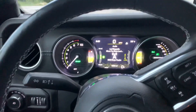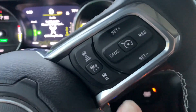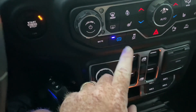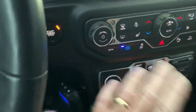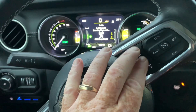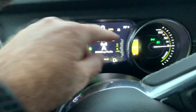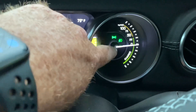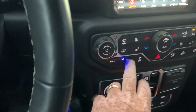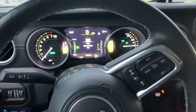What I'll demonstrate on the way back down on the other side is how to use adaptive cruise control, and regular cruise control for that matter, as an adjustable version of max regen. Coming down those mountains, we're able to set the adaptive cruise control to whatever speed we want, and it will be using the P2 motor, creating resistance to slow the vehicle to keep it right at the speed you want, whereas max regen may not hit the speed that you want.